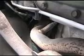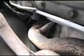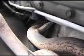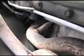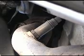So on this particular vehicle, there's a couple of different oxygen sensors. There's four. Two in the front and two in the back, and what I mean by that is two before the catalytic converter and two after. You need to make sure that your code reader is giving you the correct one, if it's the front one or the back one. It's not a bad idea to just go ahead and replace all of them. This particular one, this is what the oxygen sensor looks like. This happens to be before the catalytic converter, and this is the one that's located after the catalytic converter.